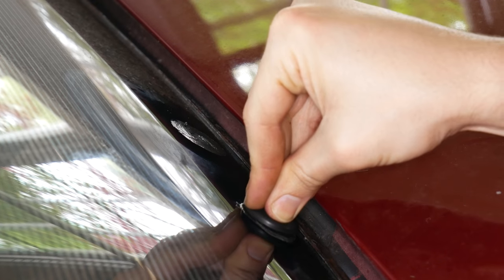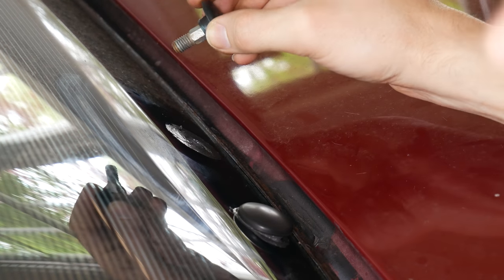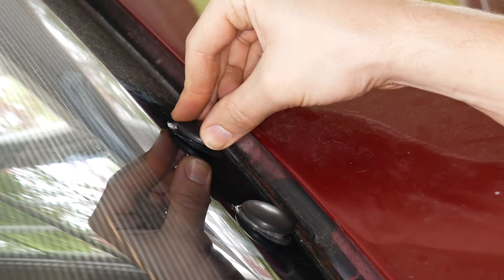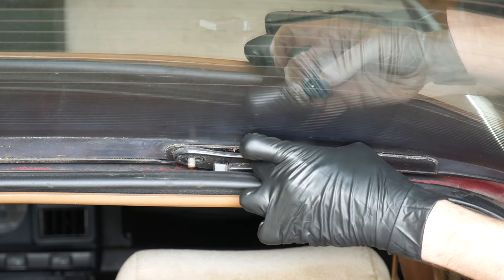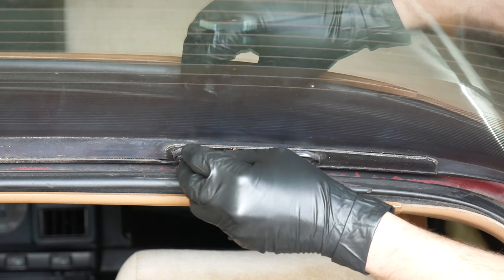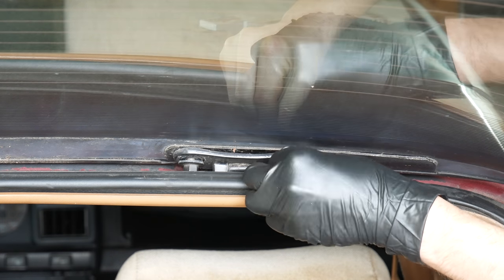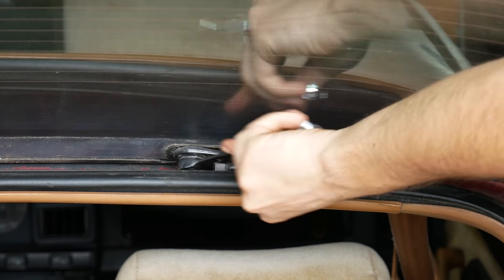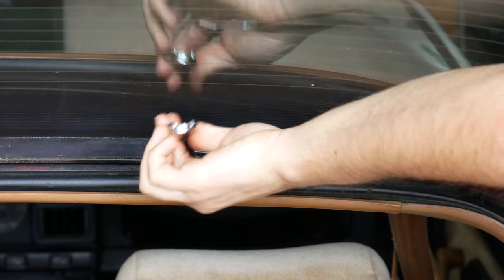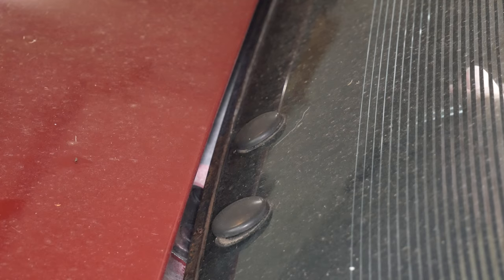We'll be installing these with the tape spacer side facing the front of the car. We have to be careful to make sure the tape stays in place and doesn't get pushed around during installation. Just like when removing them, we need to give a little push on the hatch to get the second bolt installed. Once they're both in place, we'll reinstall the nuts. For a little extra security, we're using blue Loctite on each of these — that should help balance out the fear of not getting them tight enough to keep things from moving versus breaking the glass by getting them too tight. For now we're leaving them just a little bit loose so we still have a little wiggle room for the other two bolts.